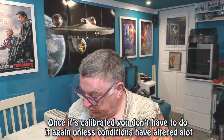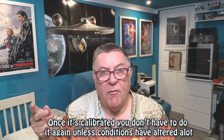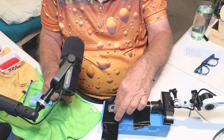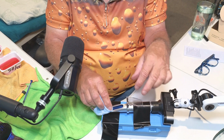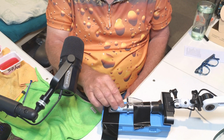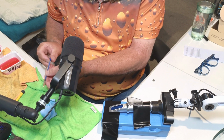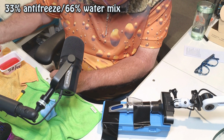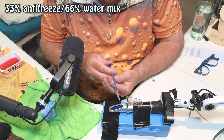So it's now calibrated, and I'm going to drop on the various mixes, the neat, the 50-50 and the 60-40 mix that I showed you before. Between each one of them, you obviously wipe the blue screen. So I'll show you doing that now. So we've now calibrated it, and we need to clean the distilled water off. So you just gently wipe that off there, and wipe that as well. And this time we will drop on, we'll start with the weakest and work our way up. So this is the 2 parts water, 1 part antifreeze.